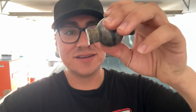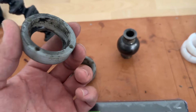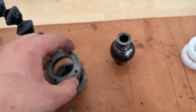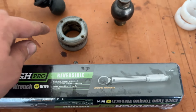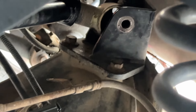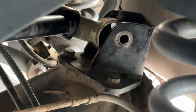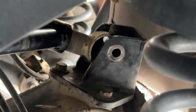This thing is super dry with no grease on it, so I'm going to pack some grease in before assembling it back together, then re-torque all the bolts including the mounting ones since they've probably gotten loose over the years. I've had this A-arm for about four years and these are currently still decent. One thing I should clarify: the small bolts that go into the bushing you tighten first to 70 inch-pounds, then another round at 85 inch-pounds. The base plate that holds the bushing needs to be torqued to 80 foot-pounds, and the bolt that goes through the bushing should be 120 foot-pounds — it was pretty loose, which I think is where my noise was coming from.